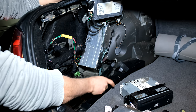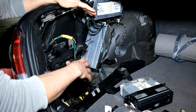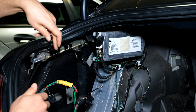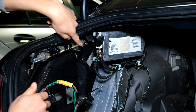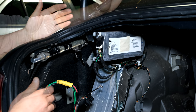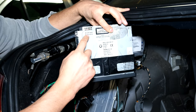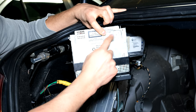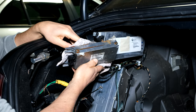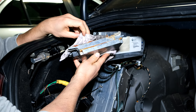The first step was to remove all the plates and brackets to get in there. I unplugged it, drove around, and now I know it is one of those two modules. What I noticed is right over here I've got the hydraulic system that operates the boot — it drips this red liquid, which is automatic gearbox oil, essentially transmission fluid. It was dripping onto the nav, and you can even see some residue. The SVS module on the other hand looks like it's pretty drenched in this oil — you can see on the seam the oil is all there.